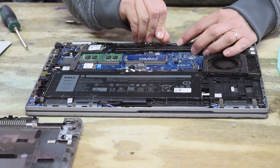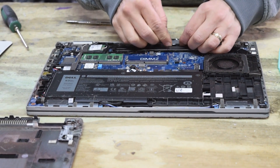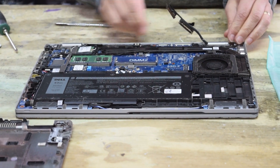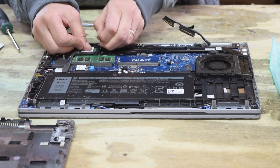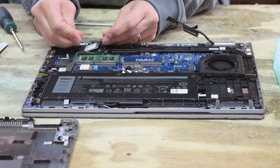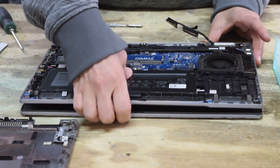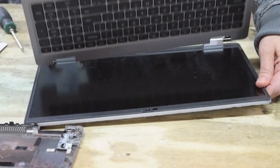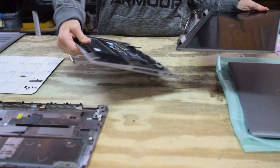There's another bracket right there, and now we're going to peel back some tape. The whole objective here is to get everything unassembled so you can get this screen out of there. Pull up and there's the Wi-Fi card — unhook the antenna wires, just snap them off. Now we've got everything off to the point where the assembly comes right off.